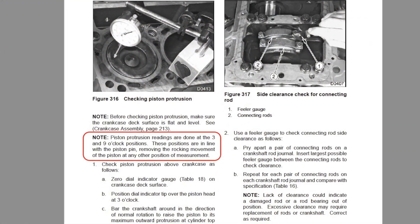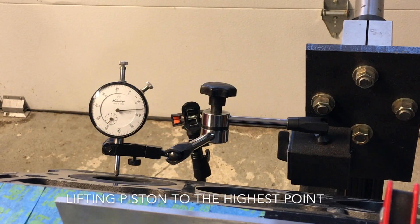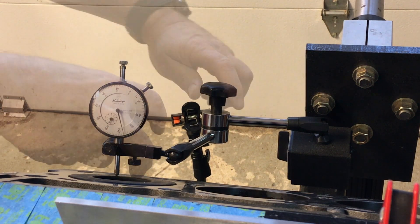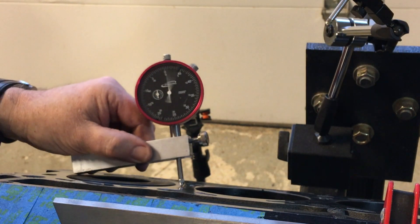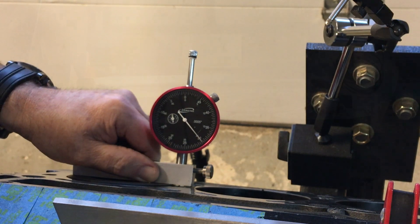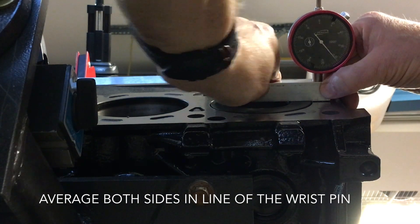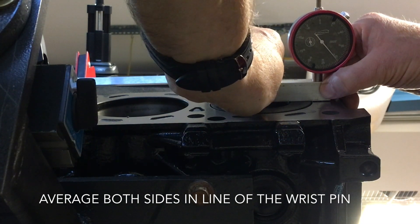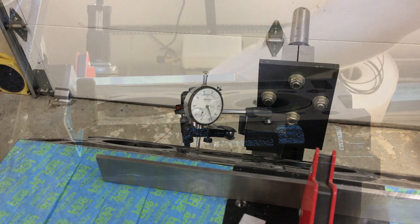The procedure is simple. Rotate the crankshaft until the piston is at the highest point, then measure across the wrist pin location. You average the two measurements, as any non-parallel conditions offset the measurements. I switched over to a black face gauge as it was easier to video.